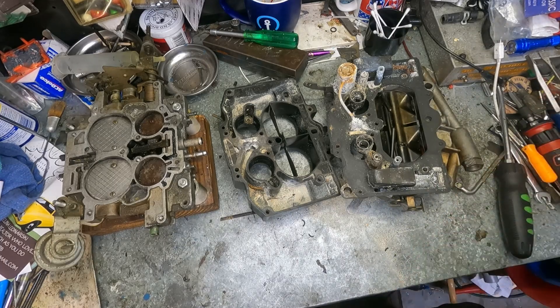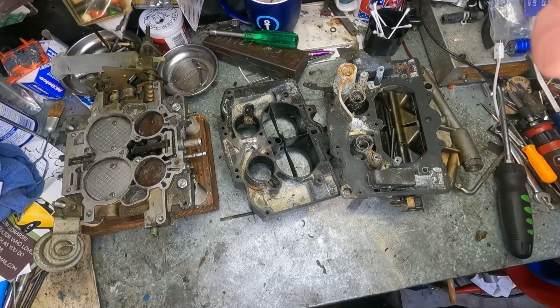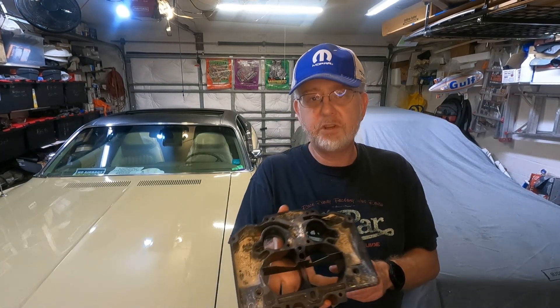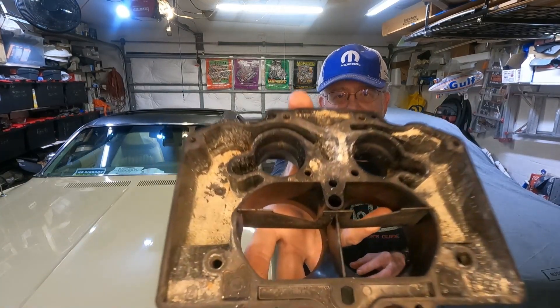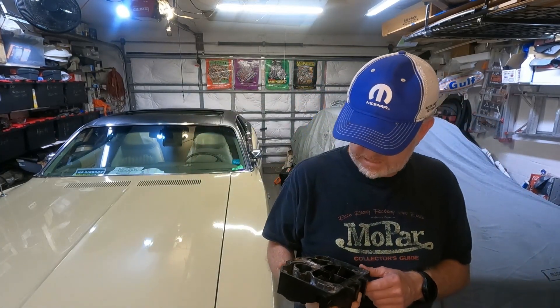So, what can you do so you don't get that? It's like pure horror — I should have had this for Halloween! Try to find non-ethanol fuel. Murphy USA has 93 octane non-ethanol, and I can run that in my 10.5 to 1 compression engine. If you can't get 93, maybe get 91 or 90 — try different octane boosters.